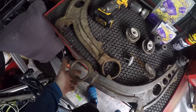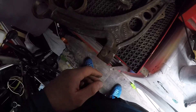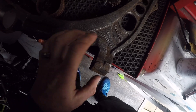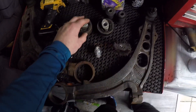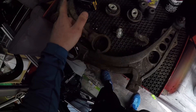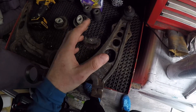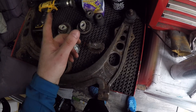Very easy to use, very simple. A little bit finicky because you haven't got a lot of space here to actually get the rod and the bolt on, but you work around that and you get it going. These came out in fairly good condition, so obviously somebody's looked after the car - there's not too much play in them. There is a mark on one of the wishbones and a corresponding mark on the anti-roll bar. The anti-roll bar bushes are in far worse condition than these, so I think that's where a lot of the play was coming from.